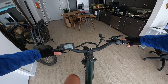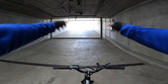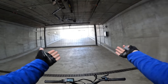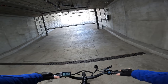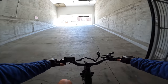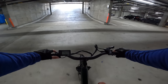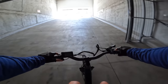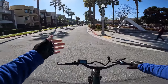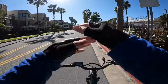Let's get it out for a ride. We'll start Strava to measure our official distance. Just like every other e-bike review, we're going to start with a 20 percent hill climb. This bike has 60 Newton meters of torque and they don't really claim it can do this, but we're going to see how it performs on throttle only with no pedaling and no rollout. From a dead stop I can't make the 20 percent grade, but with a little rollout starting at about 6.8 mph full throttle, I can roll up it. Add a little pedaling and use those seven gears and this thing can definitely do hills — it's just not a hill-climbing monster.